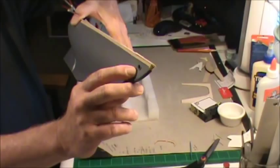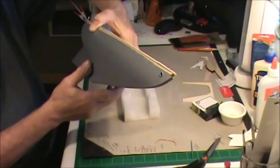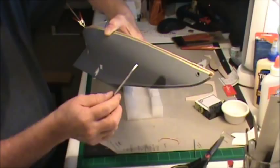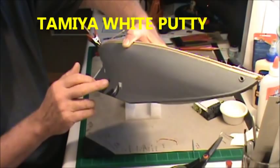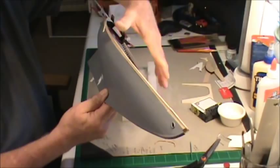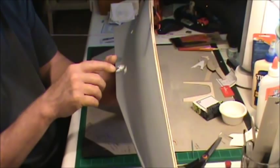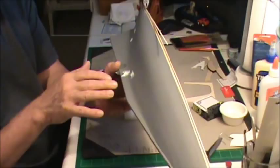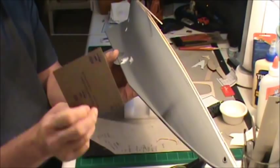I got my little pieces primed up in the front on both sides — they get painted black. I went ahead and sanded it real good, hull primed it, sanded it with a stick to find any highs and lows or bad spots, and put a little putty on those. This is about the second or third coat of putty. I got that on, sanded it, primed it again, checked every spot, sanded it again and puttied again. This will be my last putty — I'll sand these little spots and primer them. When I'm ready to paint I plan on using some 400.